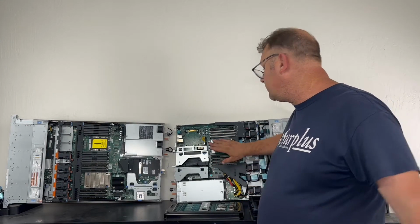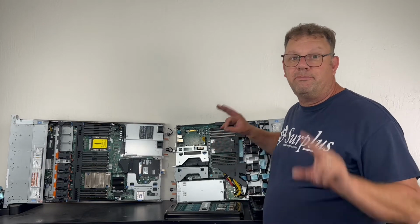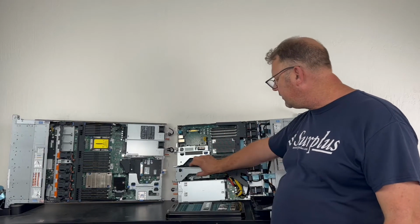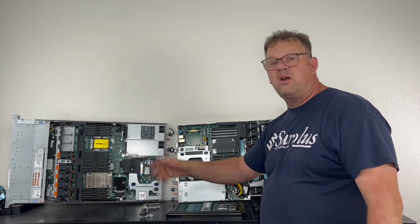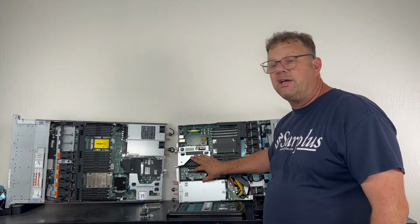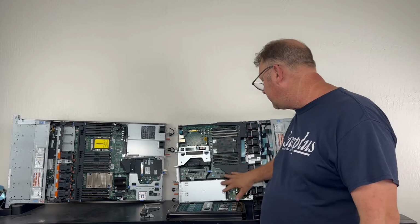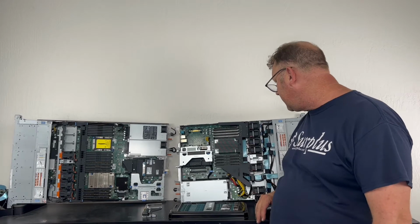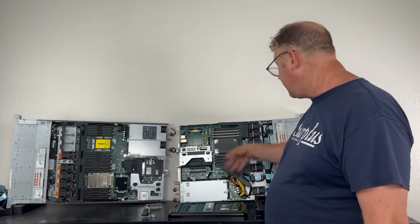So what they decided to do was a single CPU, the EPYC. You can also have it in dual configurations. They're PCIe lane interconnected, and then you get all these extra lanes. So you get a 64-bit slot right here for hooking up your 100 gig networking card. You get another 64-bit, 8-lane slot, right? A 16-lane slot here. You get here your SAS controller. You get your internal devices down here, your TPM, all that stuff on PCIe lanes. This thing right here has 128 PCIe lanes coming in and out, and memory.